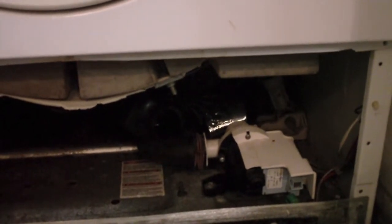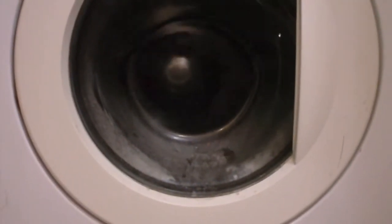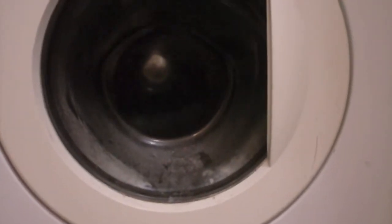The cycle has finished, so it did a spin cycle and now it's gone back to tossing the clothes back and forth. I don't know if you noticed, but there was a lot of suds in the water — that's partly because with the pump not working correctly, it probably didn't do a correct rinse cycle. But another problem is my wife insists on using too much laundry detergent. She uses liquid laundry detergent and uses the measuring cup on top of the detergent bottle. These front-load washing machines wash very efficiently with much less water than a top-load — so you need much less detergent.